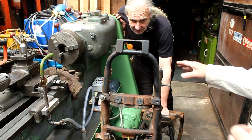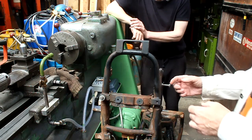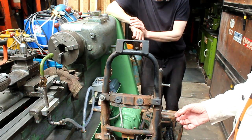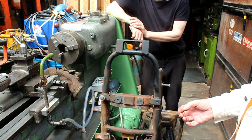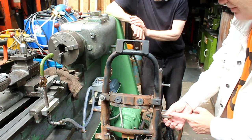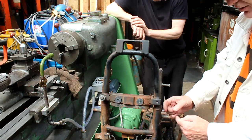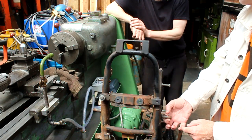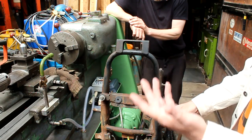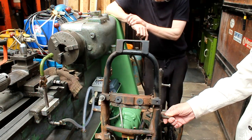On the Mark II, which you made the extensions for, Les's project, it's a two-part thing. It's got a spacer that sits there, then I think it's from a ZRX 1200 standard bike. It just screws in, like a long jet nut, and then the shock actually sits on top of that. Well, we could do with getting some of that. Yeah, I can get some. I wasn't sure where it's from, but if it is, that would be a lot easier. Yeah, I think we'll do that.